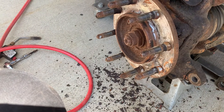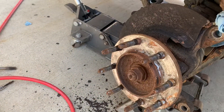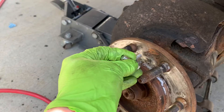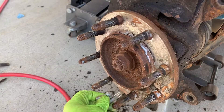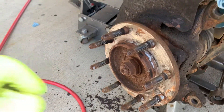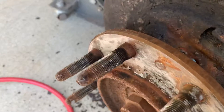You've got to take that off and take the rotor off. My rotor was kind of seized on there. What's nice about these rotors is they usually have two threaded holes — you can see the marks there. I put quarter-20 bolts in there and just go real slow and tap it a little bit. You don't want to break those off in the rotor, especially if you're reusing it.